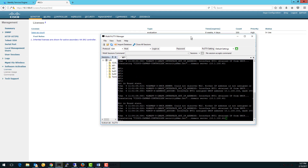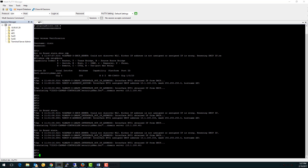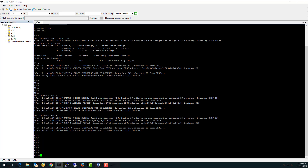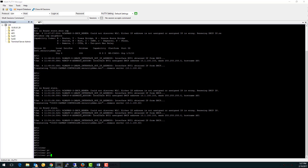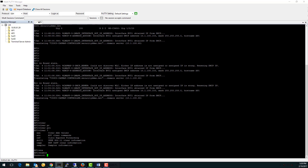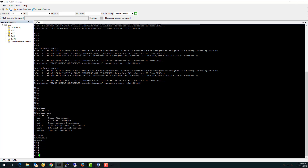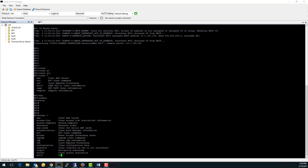This access point I'm using I haven't used before, so I want to make sure it doesn't have any config already placed in it. Let me see if it's still connected. I'm going to go ahead and just clear it. If you're logging into an access point for the first time on the console, the password is Cisco Cisco, but the C is capital in the password — just be aware of that. I usually like to clear out any configs they might have.